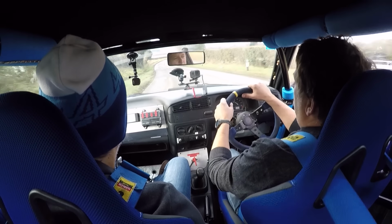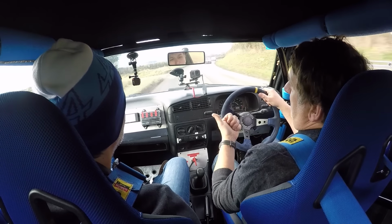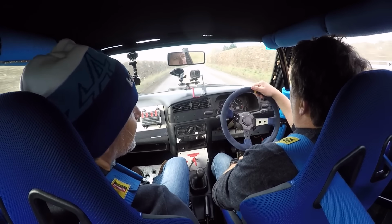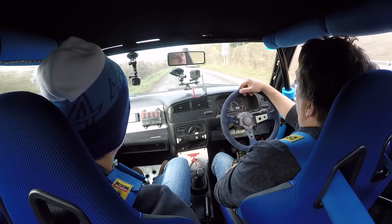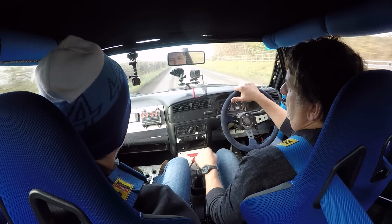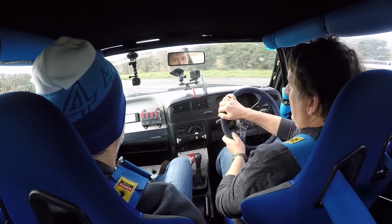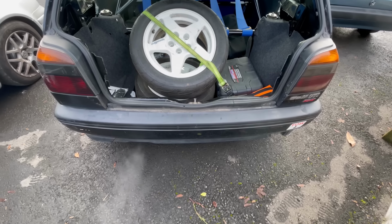That said, it can be a little bit hard on the car, so this one's built to a fairly typical spec. So it's an ABF 2 litre 16 valve. I understand it to be a standard engine, but it goes okay. It's got a hybrid Passat B4 gearbox in it with a high ratio final drive, 288mm VR6 Mk3 brakes in front and standard disc brakes at the back. EBC Yellowstuff brake pads, which really do take some heating, and you need to get them warmed up before they work at all, really.